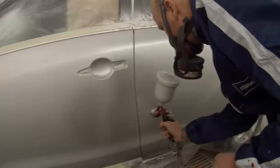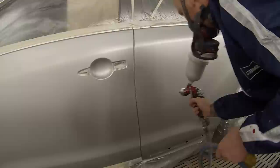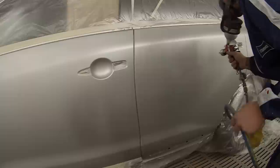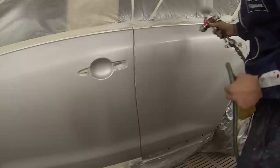The last thing you want is to carry it out front. It might look okay in the spray booth but once you get it into the sunlight you may actually find that it's a little bit transparent if you don't put your metallic on heavy enough. If you were to put your third coat on like this the metallic wouldn't look right — it would all be laying down in the flow of the paint, whereas what you actually want is the metallic to stand up by putting the last coat on a bit lighter.